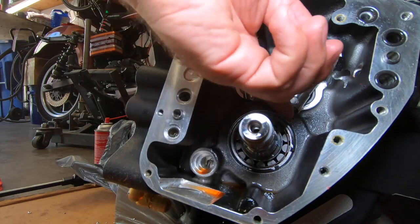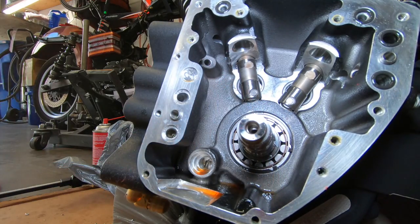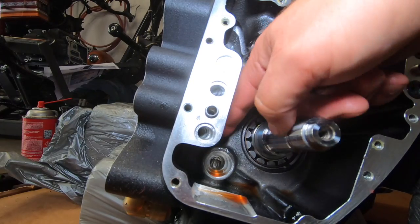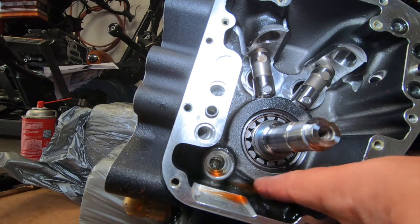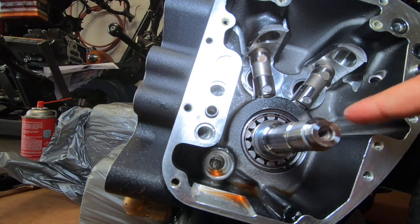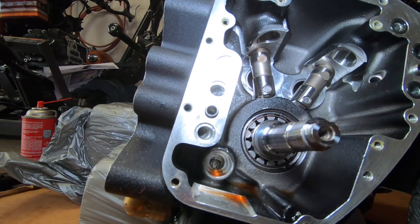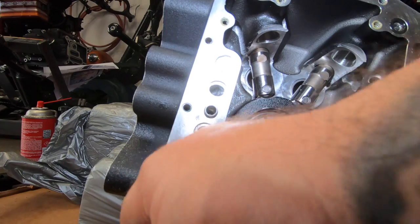Make sure your bearing, make sure all your stuff, you know, just is cleaned up. Little shavings in there. And I'm gonna do my best to clean this stuff up right now. Now, don't use red rag in here, because it'll leave this debris, and you don't want that. You want a micro towel. Right now, checking for metal anywhere here. Any big pieces?